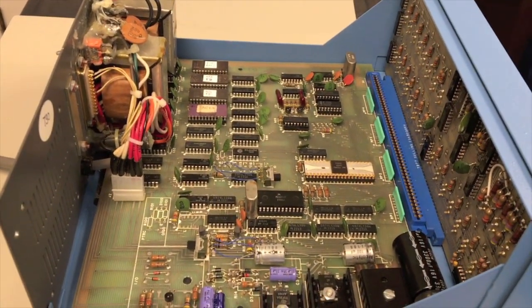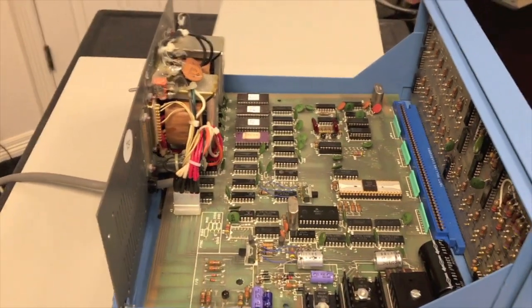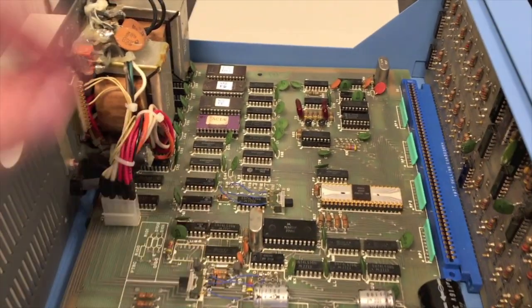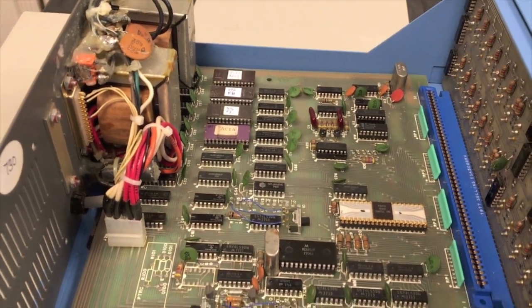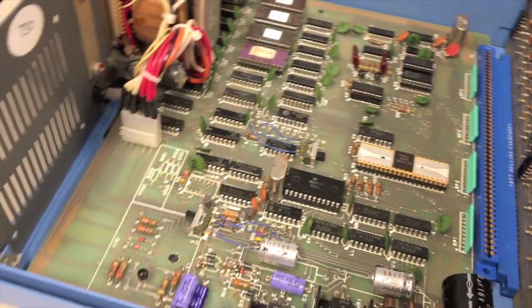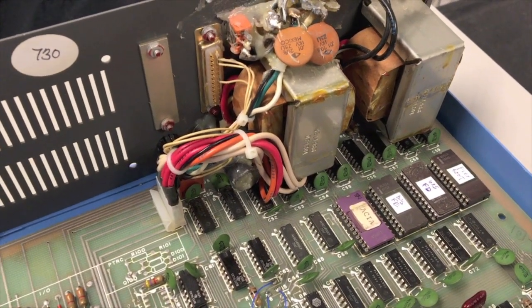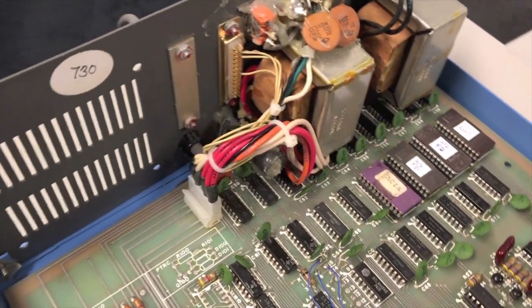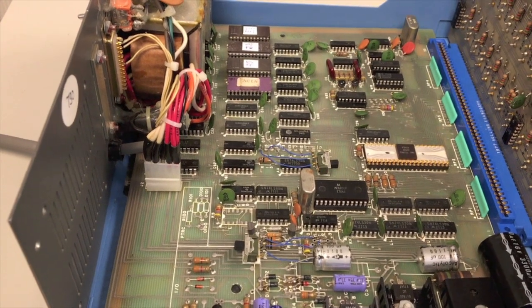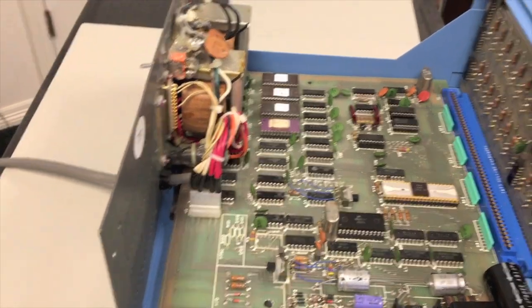The first thing you'll notice is that it does not have the bus-oriented structure of the 8800. Instead it's a single-board computer approach with everything on just one relatively small board — this is its primary cost-saving technique. Down here is the CPU and some support circuitry — that would be one CPU board in the 8800. Over here we have some PROM — that would be a second board. Down here is the 6850 UART and the interface parts to give you a serial port — that would be a third board. And behind those transformers is 1K of RAM — that would be a fourth board inside the original 8800.